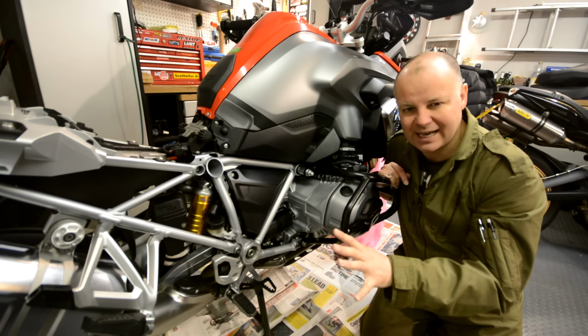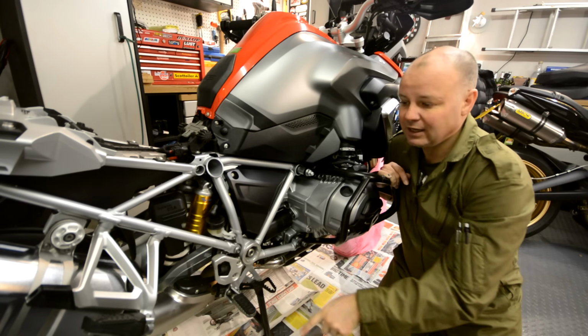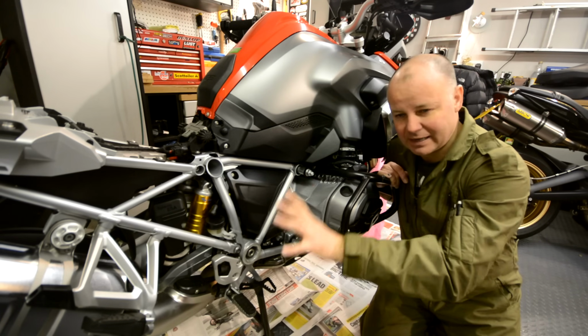What we don't want to do is obviously get the ACF50 on the handlebars where you grip it, on the foot pegs, or on the tyres, of course, because it's also a lubricant. So make sure you're careful about that. Other than that, you can spray it where you like. It can go on the plastics, it can go on the metals, it can go on the electrics.